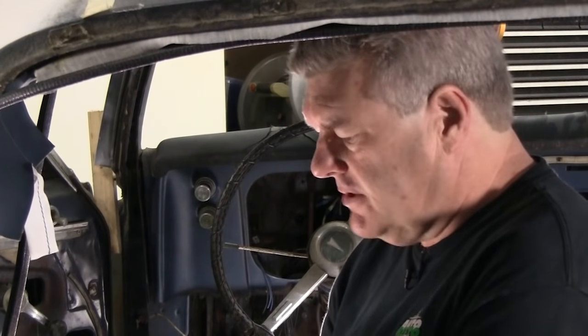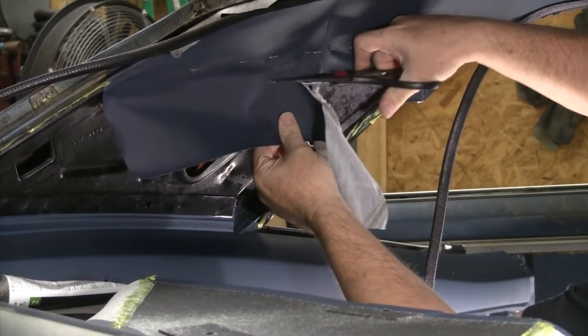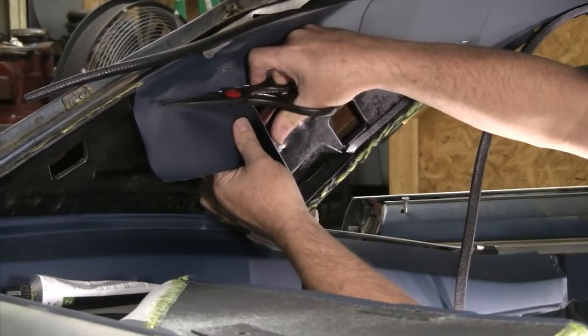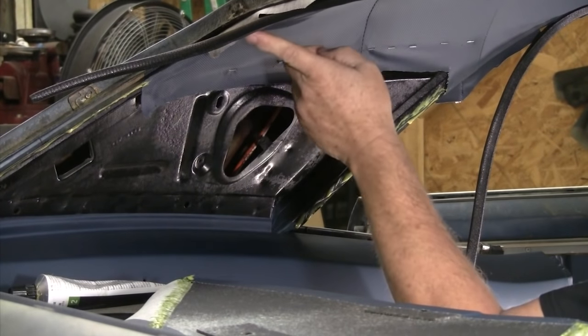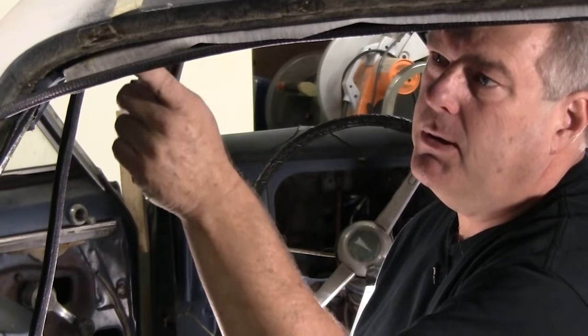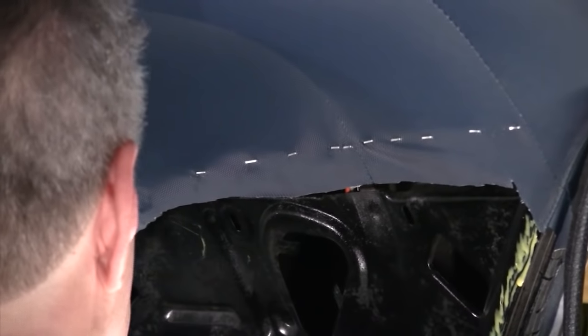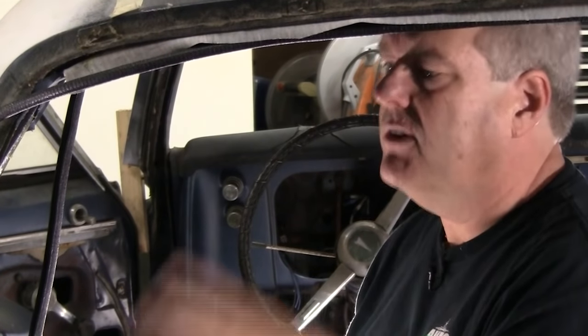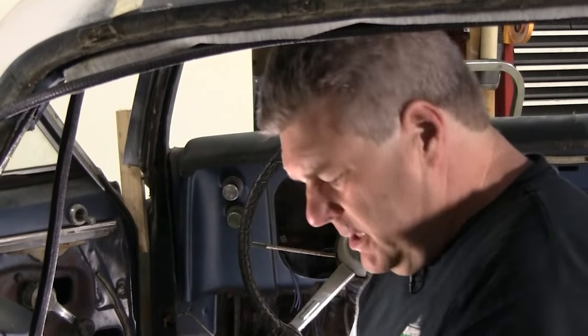First, I'm going to cut this down and take some of the selvage off so I can see where I'm at. I don't want to cut too deep toward the staples because I want to be able to yank on this down the road if I need to do any adjustments to the headliner. I've also gone in and done a little bit of glue work right here on this corner to get it to lay down and set a little bit better. There's a place in the assembly where there must be a piece of metal that drops, so I've got a little bit of a dip in my headliner right here — not that unusual. Now I'm going to make sure these places are nice and clean because right now in South Carolina we're in pollen hell. Then I'll start putting in the soft side of the Velcro, and then we'll mount it to the sail panel and throw this up in position.